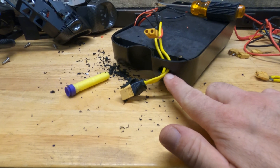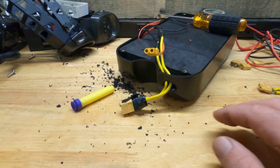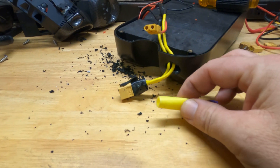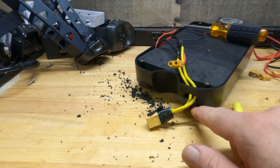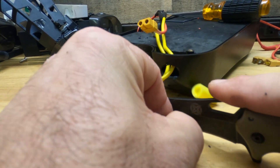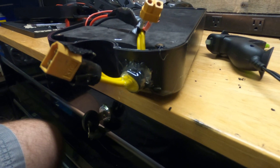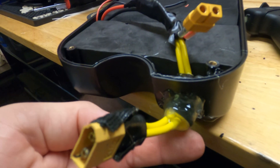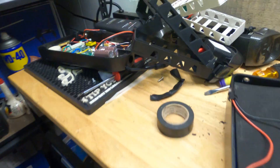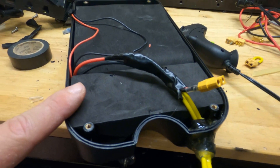You can see where the wires come through the hole — over time that could chafe the wires and cause them to short out, creating a fire right under your butt. So I'm going to cut this little dart and put it over the wires to act as padding and protect them from this edge, then put some hot glue sealer in here. I've put a liberal amount of hot glue on the outside and inside to make a good seal so no moisture or water can get into the brain. Now we'll reconnect the brain to the battery and reinstall it on the Super Ride S1000.